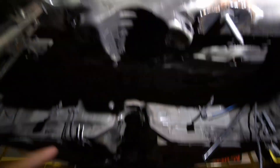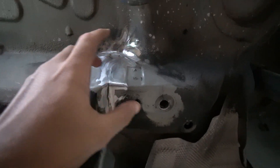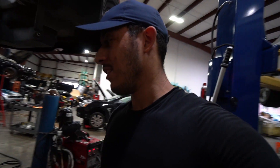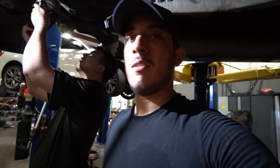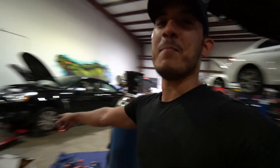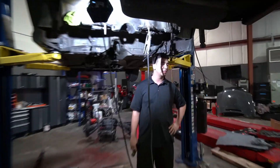Why does this start to crack? When the car takes any kind of shocks or impacts, the subframe puts a lot of pressure on these mounting points, causing them to prematurely crack. You can see a very long crack right here — the subframe mounts to this area and takes the shock, and the material here just isn't strong enough. If you have an E46, bring it over — these guys know what they're doing and do really great work.